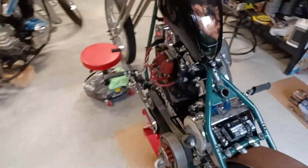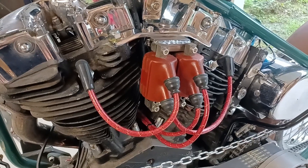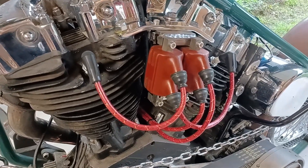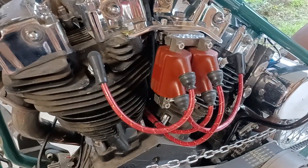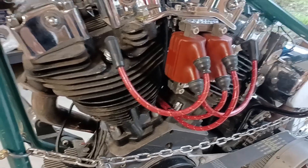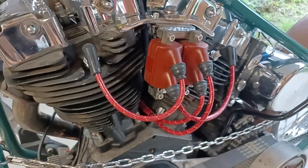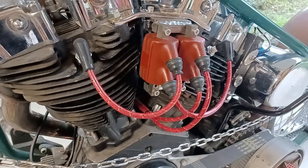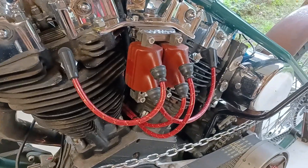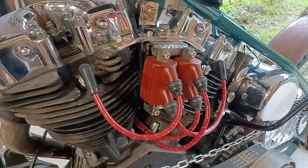Also already on the bike are the coils. Some of this stuff isn't necessarily wiring — it's more like the hardware or parts of the bike that you're connecting. These are the 1.5 ohm Dyna Tech coils, specifically for running dual coils. You wire them in parallel or series — put it in the comments — to get up to three ohms, which is what they recommend for this application with this charging system and that ignition.